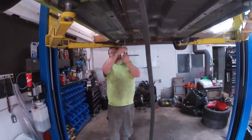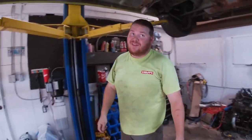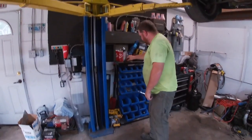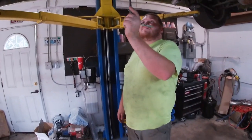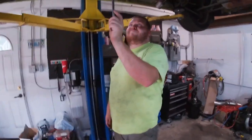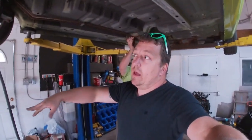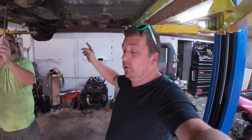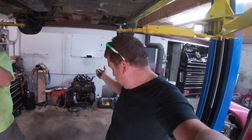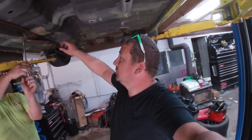It does have the regulator. It's a little overkill for right now — we probably won't even use the regulator. It'll be hooked up but it won't see boost reference and it won't see vacuum, so it's not going to be a rising rate regulator like it's supposed to be. But when we go turbo, we'll have a rising rate fuel regulator with the return line — that's what it's going to be.